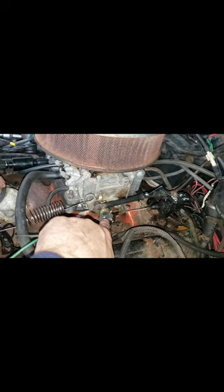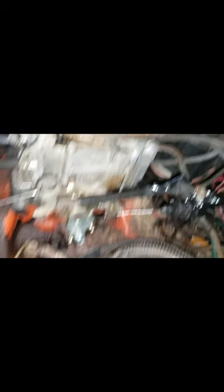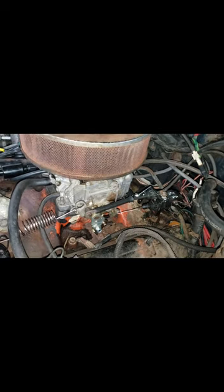Quick update: after a test drive, pretty good results. I did flip the TV cable correction piece I ordered from Edelbrock around to the other side and that really straightened the geometry out pretty good — I'm happy with that. It looks like it's hitting the choke there, but it's not. It's really close, but it's okay. Haven't had it out on the highway yet. It seems to shift into fourth a little bit late, but I can't really tell. We'll have more updates in the future, but for now I'm calling this a win. Time will tell. Thanks for watching everybody — we'll see you next time.